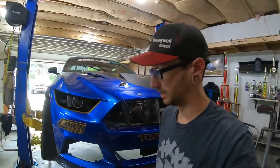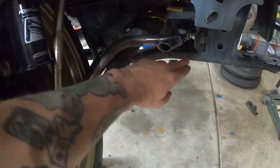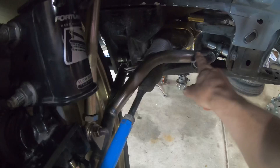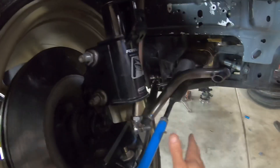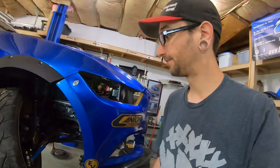So what am I doing to fix this? I've already started on the passenger side. I completely redesigned it as a one-piece control arm — it now goes over the tie rod right there. I still need to weld the sway bar pickup on, but we did a single arm with about a 53-degree bend downward. We're centered on both pickups and have full suspension travel with no binding.